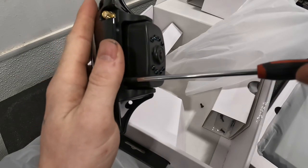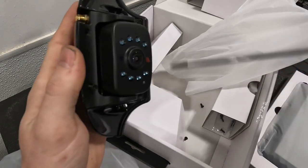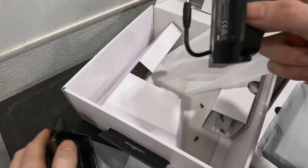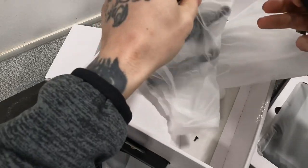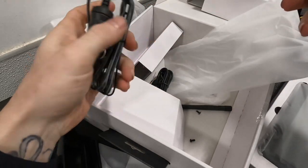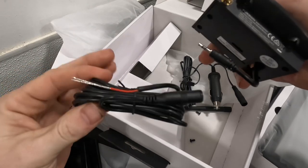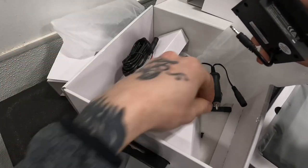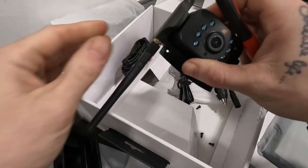I'm not saving these screws because I have these same screws up there on my dummy plate on the bracket, which you'll see when I take those off. The only other thing I have to do here is attaching the antenna, which will be located inside of that piece of cardboard. You also have a cord that will power not only the camera but the screen for testing purposes, which we're going to do before we even think about installing this. And then you have a hardwired connector — if you're not pre-wired and you're trying to run off of a marker light, you can use this harness to connect to the camera. So let's get the antenna on here.